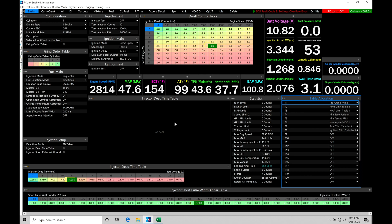If we want to determine things based on gear — boost by gear, any kind of a gear shift cut, or a gear correction (we talked about that in our 4D and 5D tables example where we were working with a fuel and ignition correction based on gear) — we have to have our gear registered properly. When we're shifting through the gears, it's going to know what gear we're in as a function of speed and engine RPM, doing a calculation and correlation between those two. So we need to make sure our speed is calibrated first, then we'll move into gear determination.